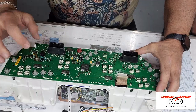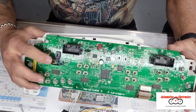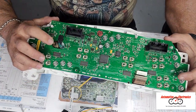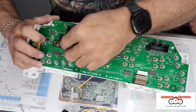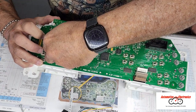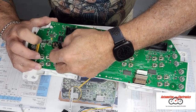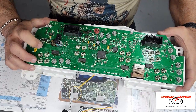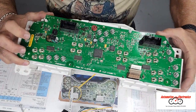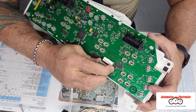As we took this apart, it's a little different in the back than your typical F-150s. It's got the boost gauge, which is a mechanical gauge. And it's got the electroluminescent display that plugs in right there next to it — you just push that tab and pull the wiring out. At that point you'll want to get your odometer display disconnected over here.